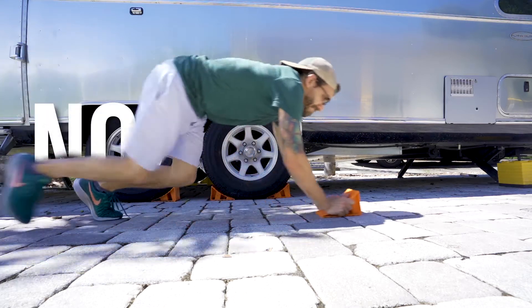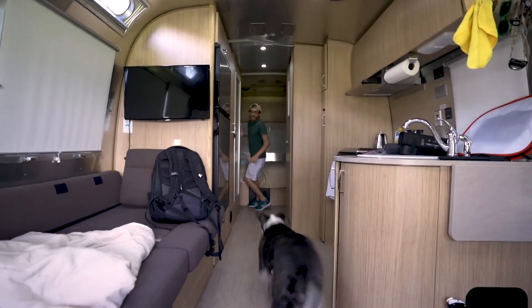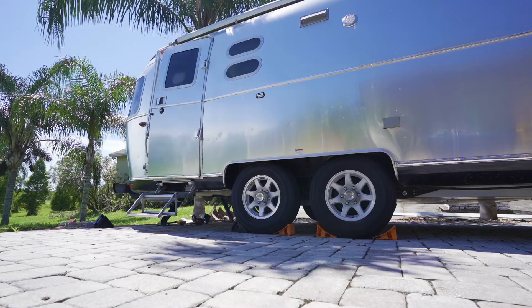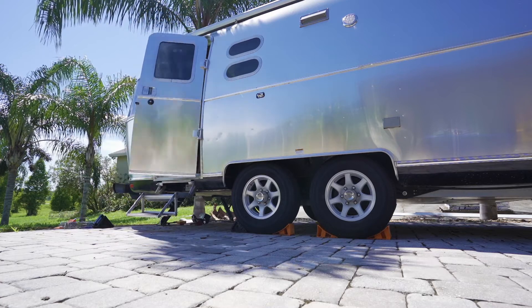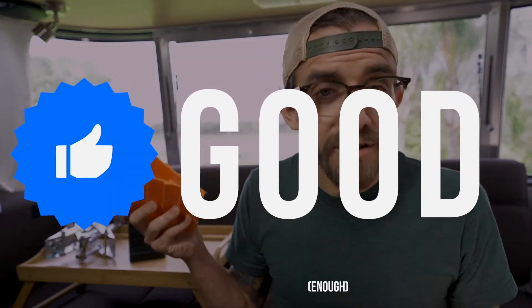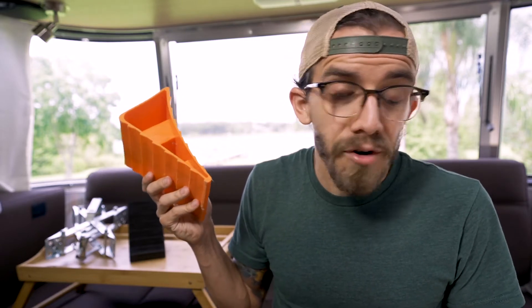If they slide enough that it creates a little bit of wiggle room with your wheels, you might be able to feel that when walking around in your trailer — moving from the very front to the back, you might find that your rig moves just a little bit, which gets uncomfortable over time. Then you've got to go outside, kick the thing under the wheel, and that's an extra step just for you to enjoy your time camping. Overall, these get a rating of good. They're good because you can get them just about anywhere and they'll do the job for the most part, but maybe not to be trusted with heavy rigs or on a steep slope.